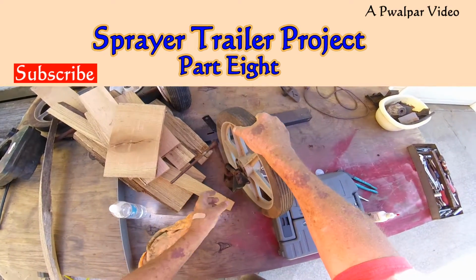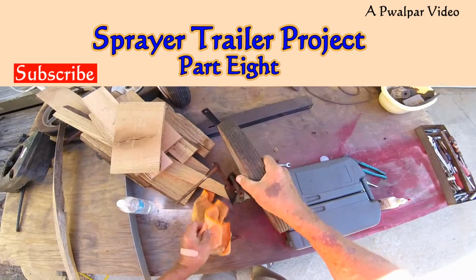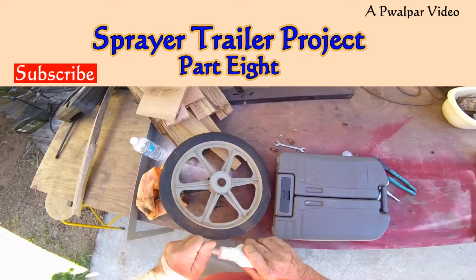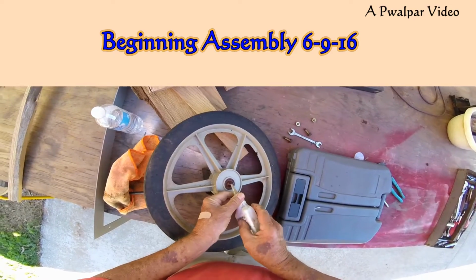Rear wheel assembly for my trailer, and it's covered in grease and crud. I need to try to take it apart and clean it with some gasoline. The nuts rusted on there pretty good. Put a little penetrating oil on there and let it sit a little bit.